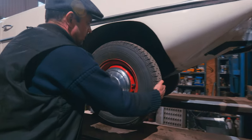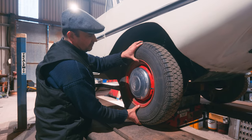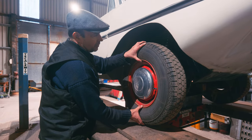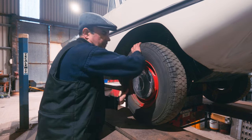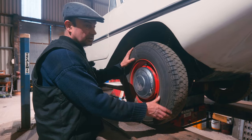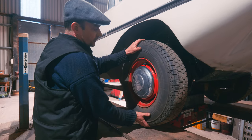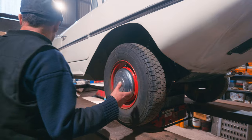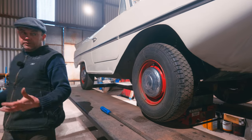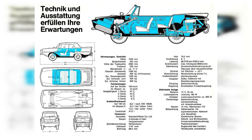I want to see if we can feel any play anywhere. Obviously got a bit of play in that - we've got play in the wheel bearing, we think. Let's spin it and see what it sounds like. How noisy that wheel bearing is. Why is it so noisy? Because it's been full of water, hasn't it? So we use special grease on these that's water resistant. But unfortunately you still get water ingress, so pretty much every year we're putting wheel bearings in it.